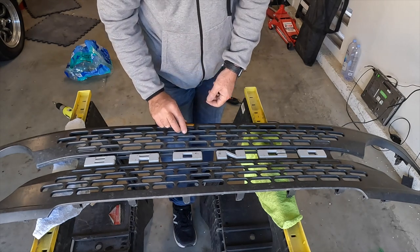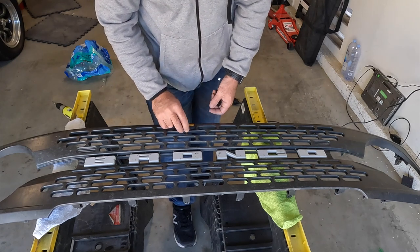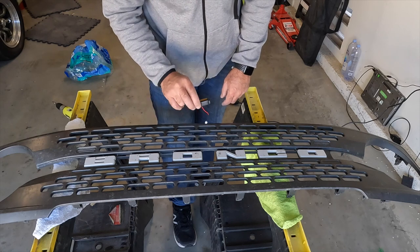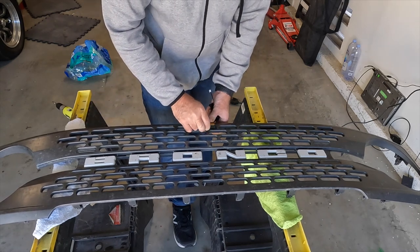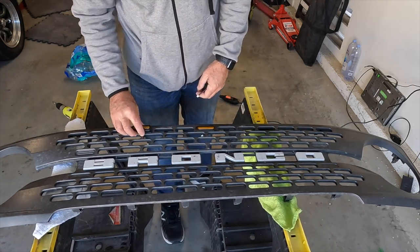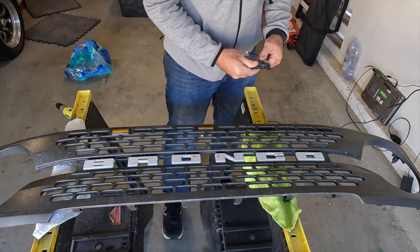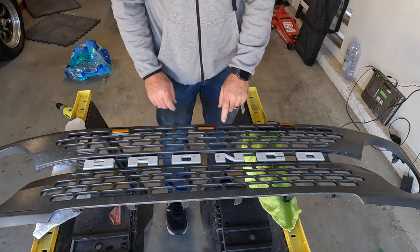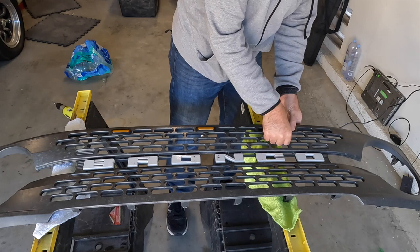You can see this is where we want to put our lights. Make sure you're counting the holes in the grill to make sure you've got it centered. I did my count and realized it wasn't even — I needed to move it over one spot. Now that middle one's centered, I can go ahead and figure out the placement for the other two. They just clip right in, push in, snap in place. I liked the way it looked with three empty spaces between each of the lights.